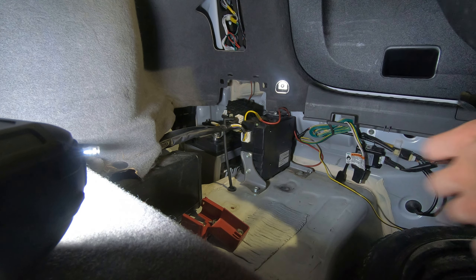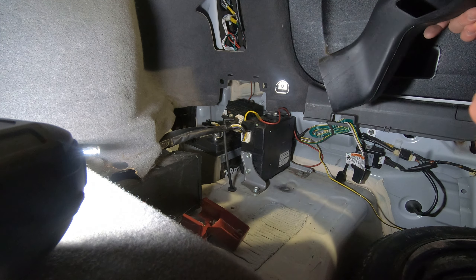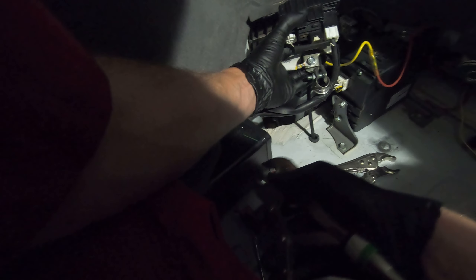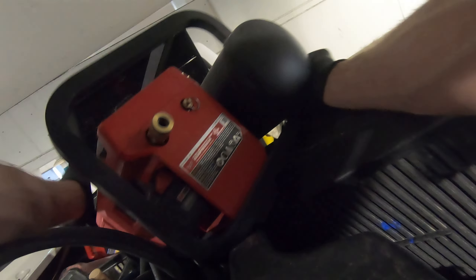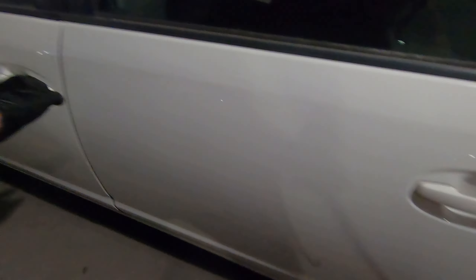We have this air vent that vents the battery to the outside of the vehicle. I'm going to crimp the terminal clamps so they're oval-shaped, clamping on two sides instead of however many contact points they'd normally have, since they're not going to line up perfectly with the new battery posts. It'll still have two good contact points and a tight grip. We'll order the OE clamps and get those installed when they arrive in about a week.